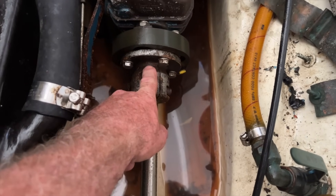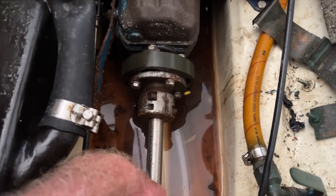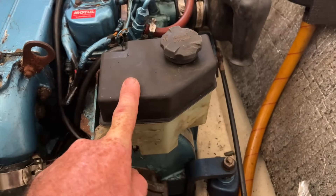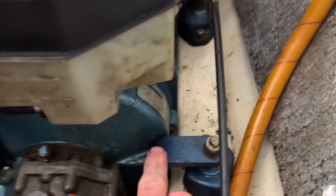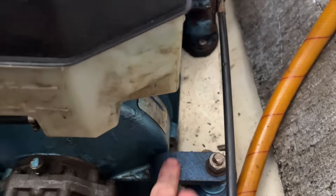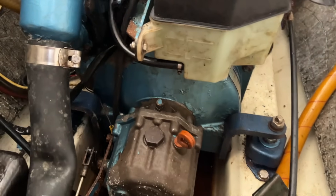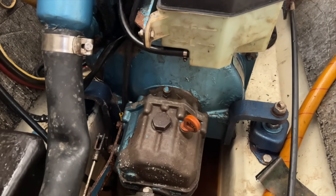To get this thing out, I'll show you what I've got to do. I've got to undo the coupling for the drive shaft, slide the drive shaft back, take the exhaust pipe off, take the water coolant overflow off, take the gear cable off, undo the two engine mounts, and then there are six bell housing bolts all around the connector bell housing to the engine. Then you just slide it off - it's quite easy.